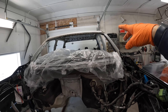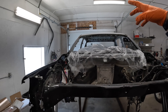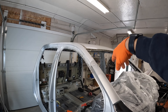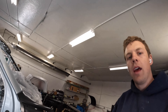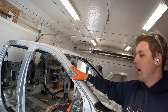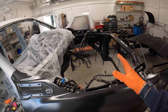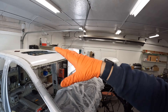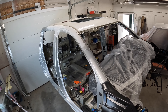I still need to cut the holes for the cab lights — I have a template off the old roof skin so I'll just put that up there, drill and cut them out quick. Then I'm pretty much ready for paint. Just need a little filler in those three spots and that one little ding, then I can sand it out, put high build primer on tonight, and come back tomorrow to sand it out and get it ready for paint. I'm also thinking I want to do the roof black and throw some metallic flakes in the clear coat — black cab lights, black top, silver body. I think it'll look pretty sharp.